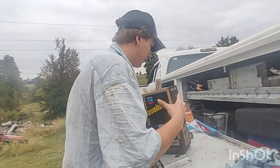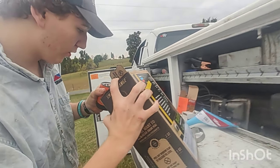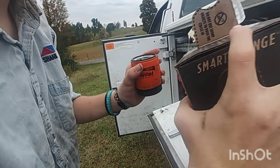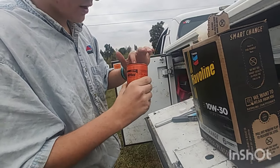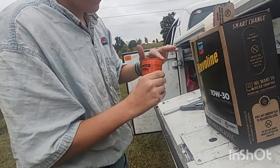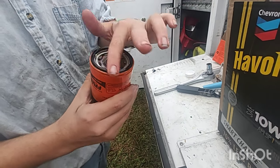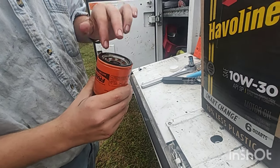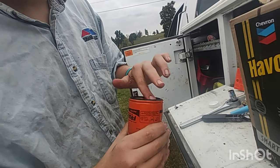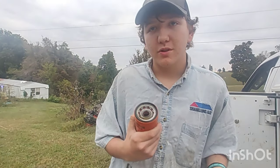So what you do is take your oil filter nice and handy right here and pour a little oil on it — that's probably too much, but it's there. Spill oil all over the place. Take it and put it up on the ring, and run it around a few times. Make sure you get in there good and get that little black ring covered in oil, because if it's not, it will not seat properly and then you'll have to replace it again in a few minutes. That looks nice and oiled up, so let's go put it on this time, preferably without having to stop.